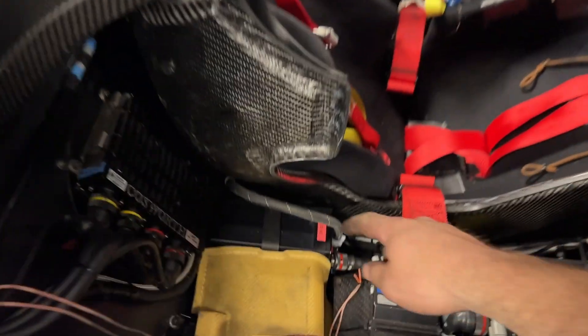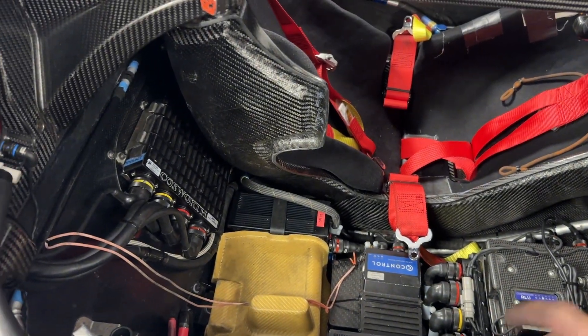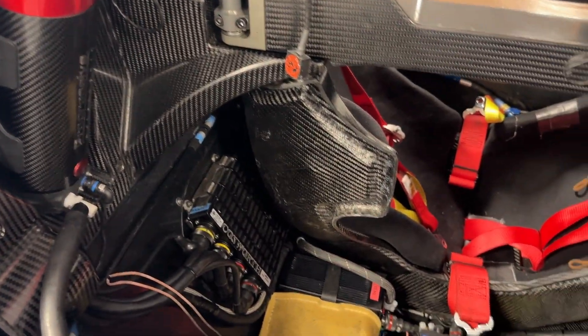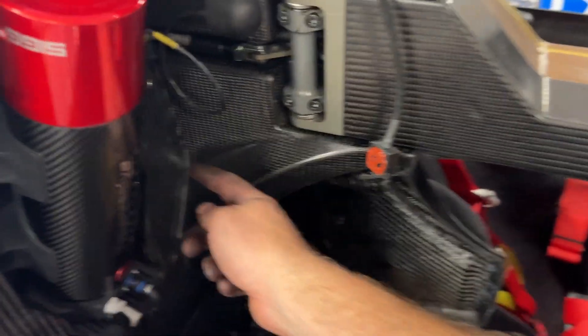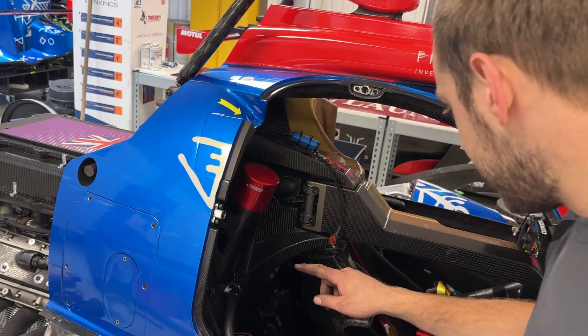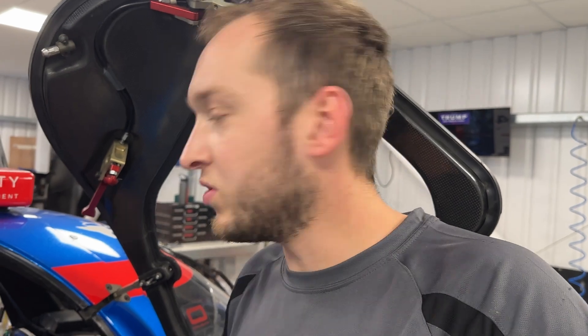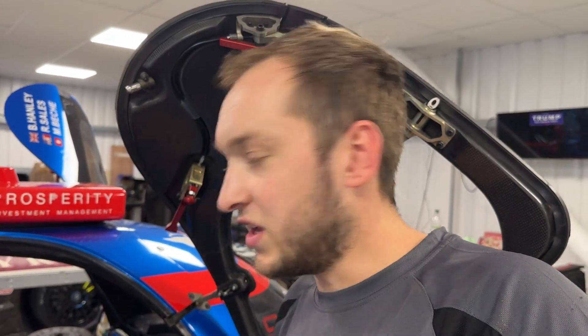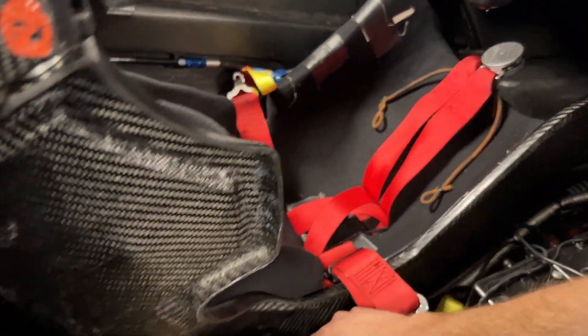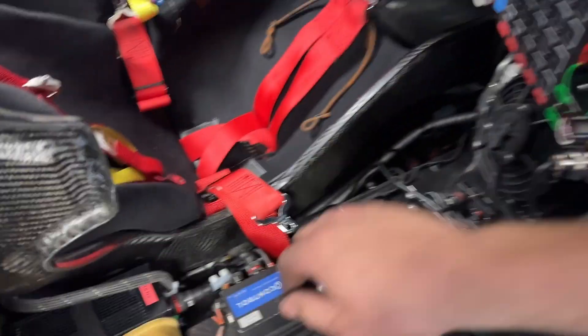How the system works: you've got the compressor here. That compressor is for two reasons — the neutral switch and also for the gear shift on the gearbox. It compresses the air and it goes into a tank just behind the bulkhead. From the air tank, the air is stored, and then there's an air cylinder on the end of the master cylinder with a push rod rather than attached to a pedal. That compressed air fires the piston inside the master cylinder, which then pushes fluid down to the slave cylinder. It's in theory exactly the same as the driver pushing down the pedal, but it's air operated from the extra master cylinder. Let me plug the compressor in and I can do a little demonstration for you.